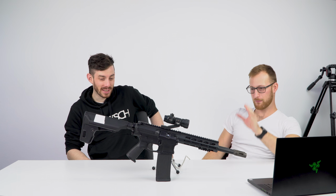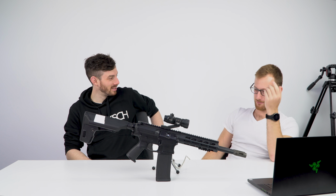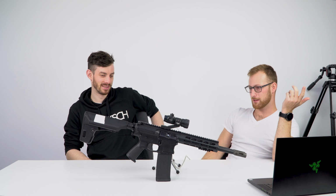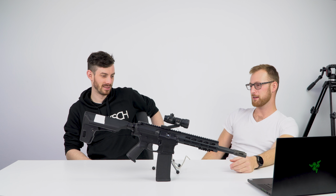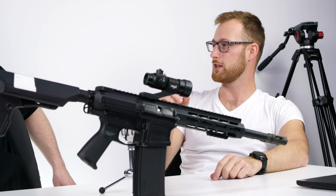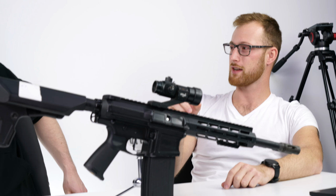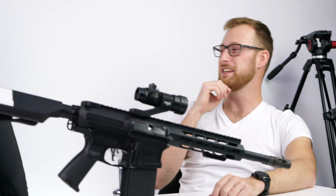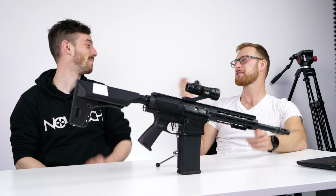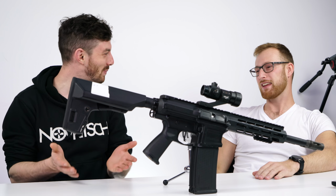It was nice. So how did you break it? I broke it after the game. I broke it because I was doing something with it. I wanted to change something. I don't even remember what it was, but I was too lazy to check the wires. I was changing the connector to Deans. It had Tamiya connectors and I was changing to Deans, and I soldered it the wrong way because the cables were both black. It's two black cables. Yeah, yeah.